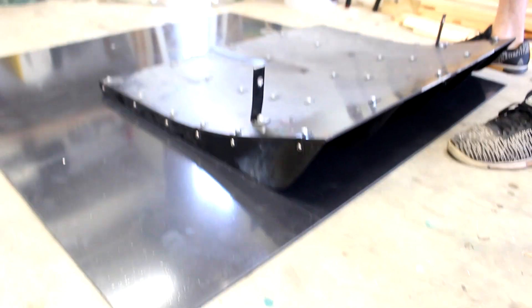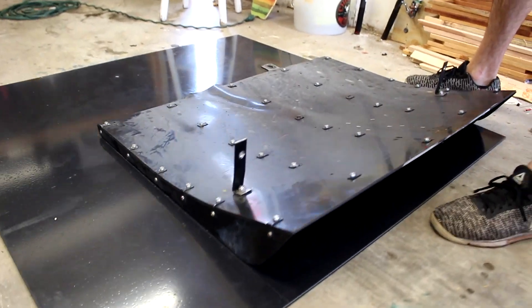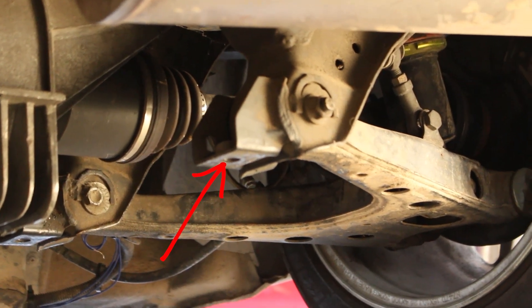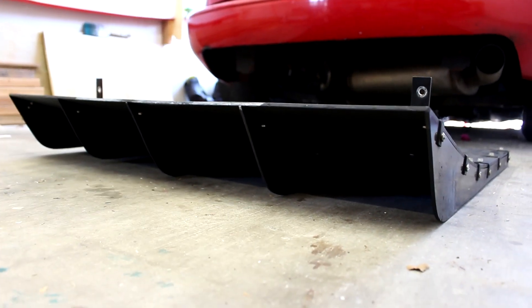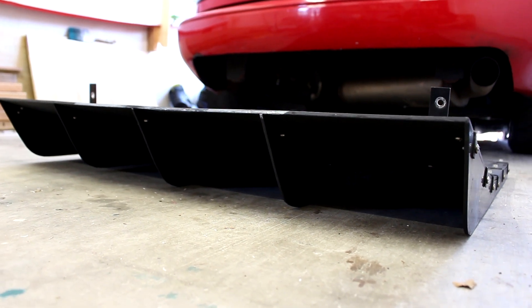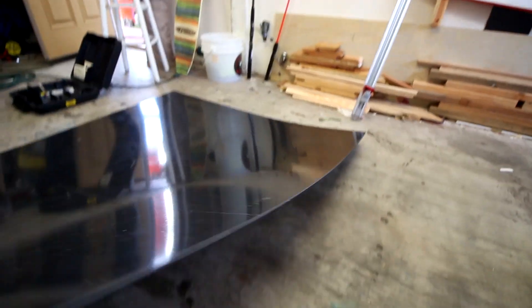The first thing you need to do is mark up and cut out the main base plate for your diffuser — this is going to vary based on your setup. You can use an existing diffuser to mock this up, but you just need to measure from your mounting point (in this case the rear holes on the subframe) and measure back however far you want the diffuser to hang. For width, I measured the space between my exhaust tips, which was 36 inches, and decided to make the diffuser about 35 inches wide, leaving half an inch between each exhaust tip. Keep in mind the exhaust gets very hot and it will melt ABS plastic — this is 3/16ths of an inch thick or five millimeters, and I'll link what I used down in the description.